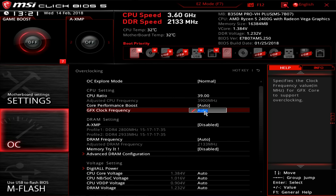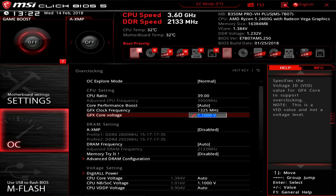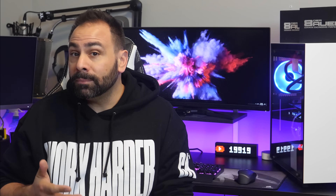The same goes for the GPU, although this time you have to actually enter the exact frequency you want it to run at. In order to do this, you'll need to know the base specs of your APU — for the 2400G that's 1250 megahertz. Going any lower than this doesn't make much sense unless your aim is only to save power, and going too high will cause artifacting, hangs, blue screens, and even boot failure. Step up in 25 megahertz jumps until you start to experience problems, then back it off one step. 1350 was too high for me and caused crashes, but 1325 seemed just right.